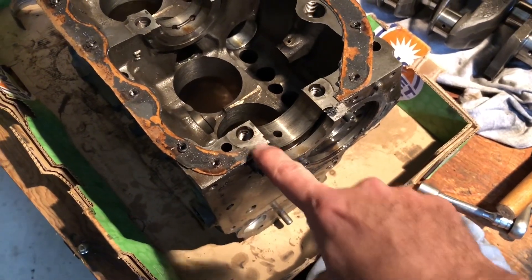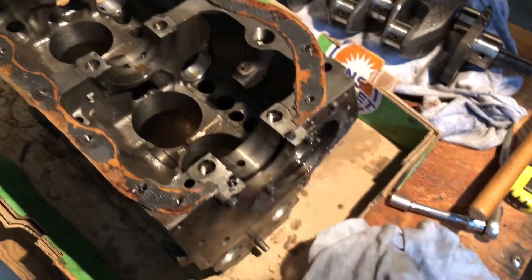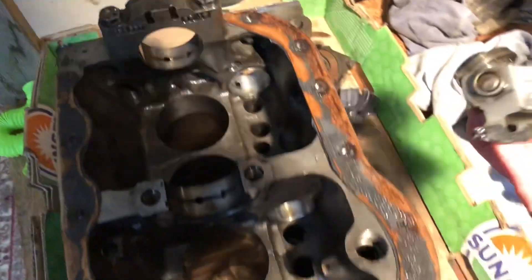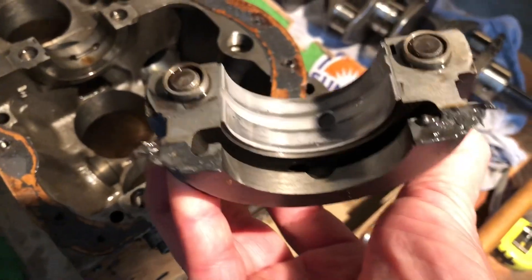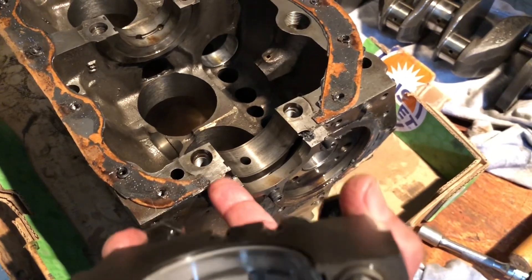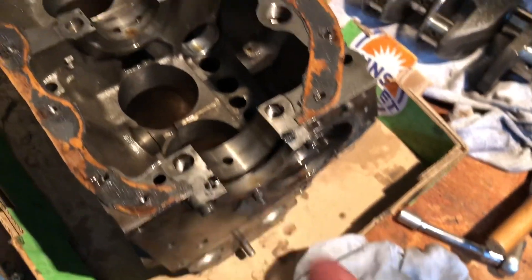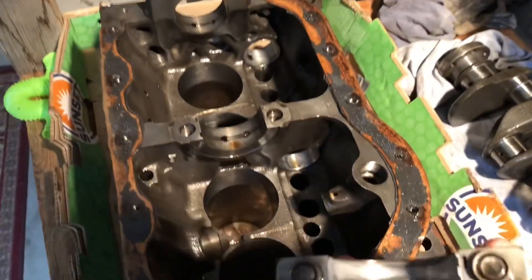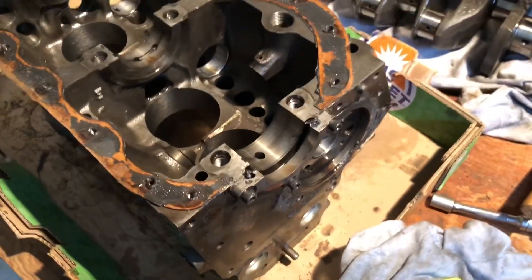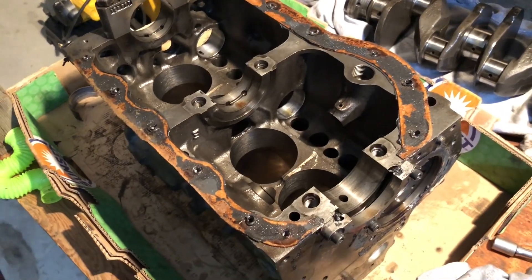If you allow a gap here or here in the way this piece fits over the rear main cap, let's bring it over and take a look. You see how it's flush? The rear main cap has the other half of this piece. When these are removed and haphazardly installed, you've got no chance of making this seal. If you do it right, you have every chance of creating a seal that will never wear and will work indefinitely. And that's the way we like to do them.